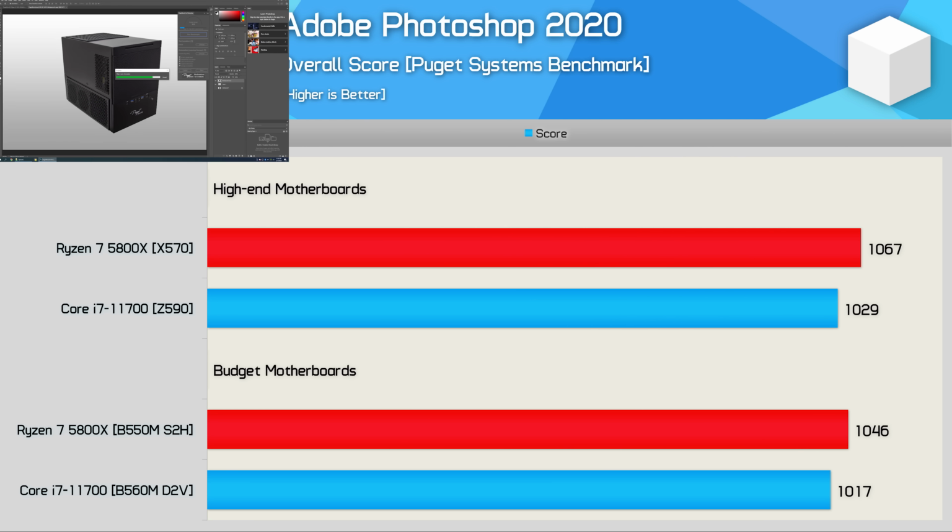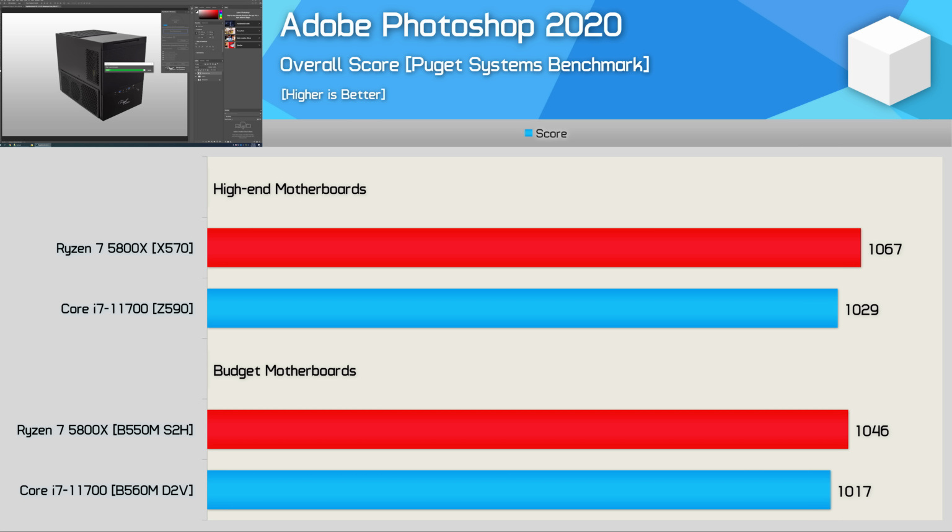As was seen when testing with 7-Zip, not all applications heavily utilize the CPU, or at least don't necessarily do so for extended periods of time. Another such application is Photoshop 2020, which typically only uses a few cores, and that means the TDP power budget isn't exceeded here, allowing 1 to 2 cores to run at their maximum frequency indefinitely. And the same was true of the X570 and B550 configurations. So if you're predominantly using software like Photoshop, the motherboard and its VRM doesn't really matter. That said, you've potentially wasted a lot of money on an 8-core CPU that you don't need, and at least in the meantime, aren't using.